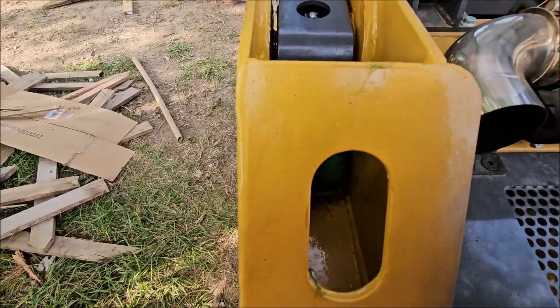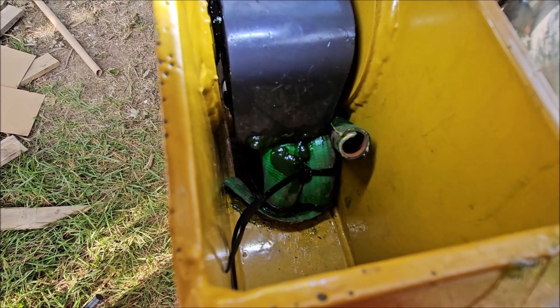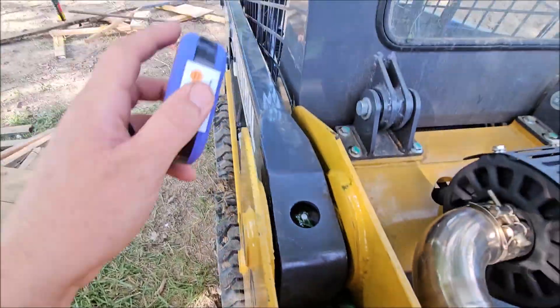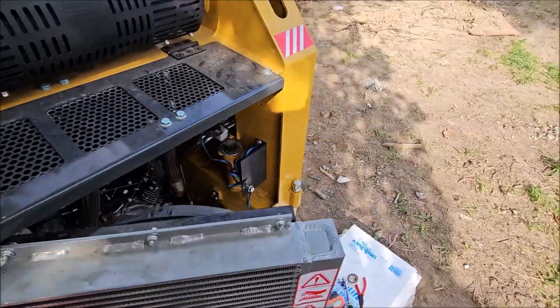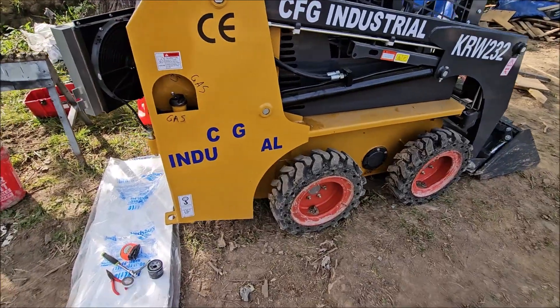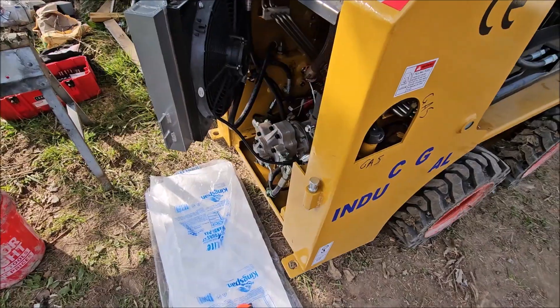Here's what I did for these here — these are very bad. You can see down in there how I've got a bunch of pieces of rubber hose, zip-tied and greased up around my hydraulic hoses, because those were rubbing really bad on the bucket pivots going up and down. By the way, this is a CFG Industrial KRW-232 skid steer, but this guidance goes for any equipment that you buy from China.